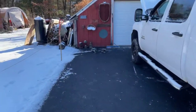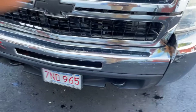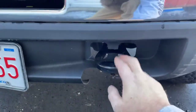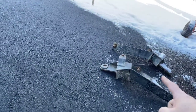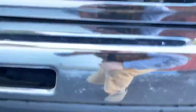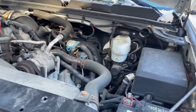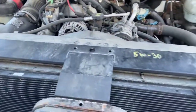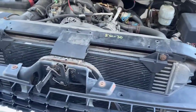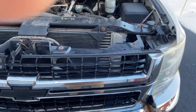In order to put this plow back on the truck, the first thing we're going to have to do is mount the receivers where the plow slides into, back into the undercarriage here. I had put on these hooks, so you can see it was cut out before for those receivers. I've got to take the hooks off and put the receivers back in, bolted to the frame. The other thing is, they took all of the wiring off of this truck — the module that controls it, the power wiring, the light switch, the swap-over. So when you put the plow in and plug it in, it switches over from the regular lights to the plow lights. I've got to put all that wiring in, so the grille has to come off and the lights have to come out, and the harness will go on.